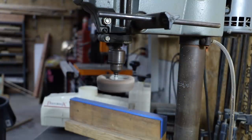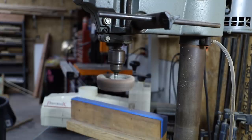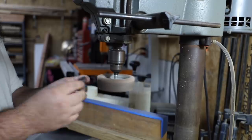Now back to the lugs. To finish polishing them, I hit them on the buffing wheel, but instead of using a buffing compound, I used a spray-on car wax polish. This is less abrasive and will also give them a little bit of protection.